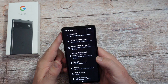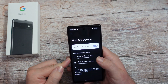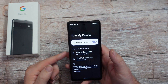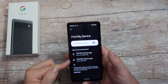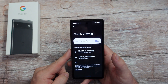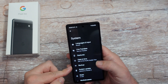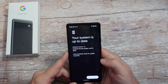Under settings, go into Google. One of the major things you want to have turned on - it probably already is - is Find My Device. Go in there and make sure that's turned on. It allows you to find your device from a website or the app, you can buzz your phone even if your ringer is off and see it on a map. Under settings, go into system - this is where you can check for updates. Go to system updates, check for an update, and install them.